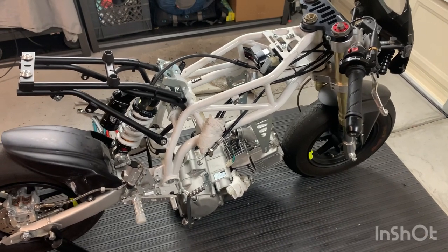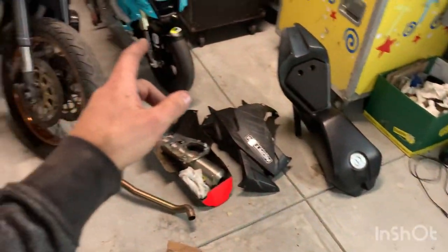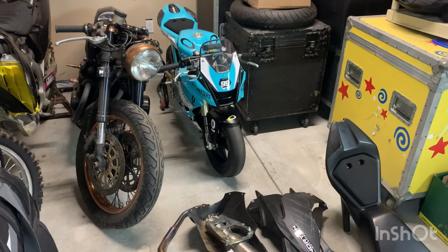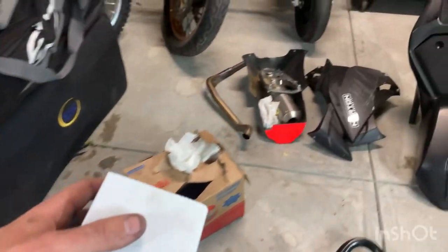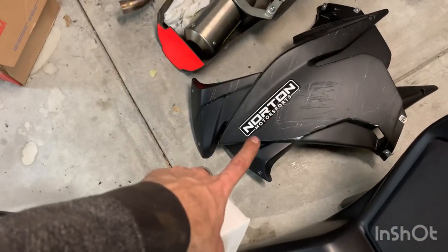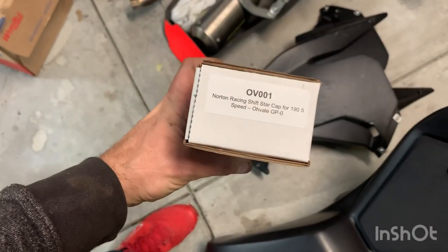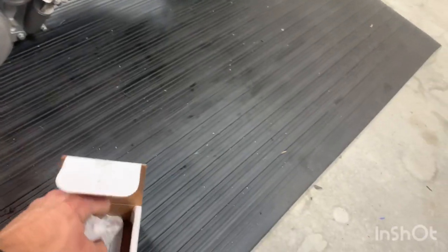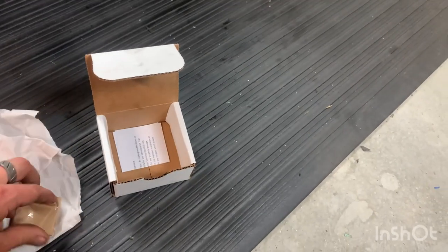Comment below if you have any questions. I'm going to have a follow-up part two video. I probably won't show taking that motor out, but I am going to open the side cover, drain the oil, open the case, and install this washer I have. It's from NortonMotorsports.com — I'll put the link below. He sells this part: it's the Norton Racing Shift Star cap for the 195 five-speed. There's a little instruction sheet. It's a super small mini part — a little washer, two sizes, with a through hole.